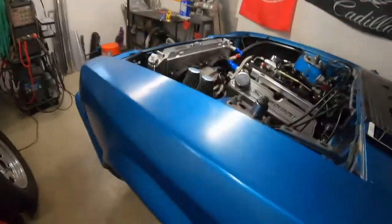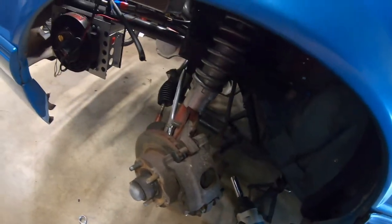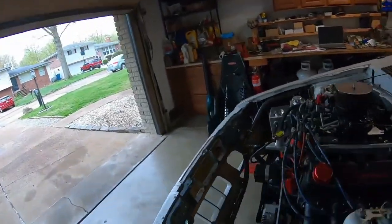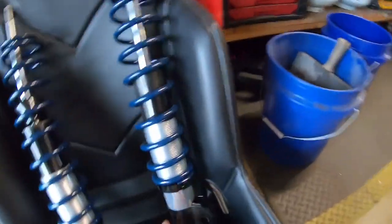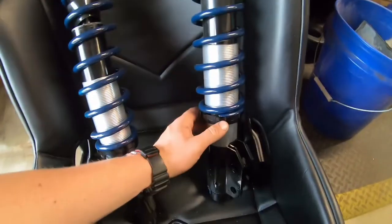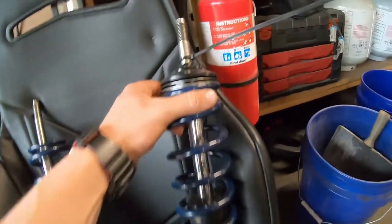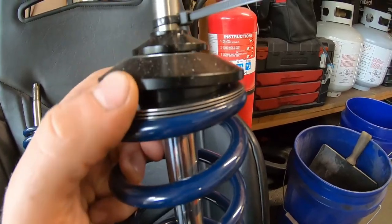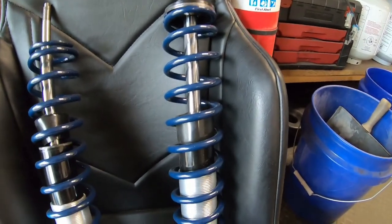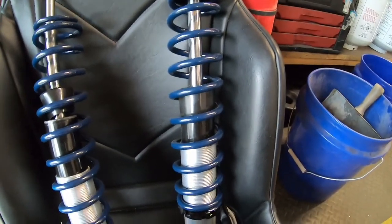There's some other things I have to change on the truck that I'll show you guys in another video. But I think I've been rambling long enough. MJ, you done yet? Yeah. Alright, we're going to finish these up and I'll show you guys when it's done. It's super simple — all you gotta do is assemble the whole strut setup on the bench. All it is is a sleeve, a couple jam nuts down here, the collar, the bearings up here, and the spring. Really easy — I'll show you guys when we put this in.